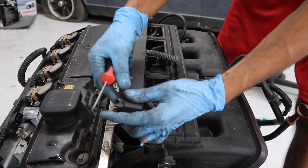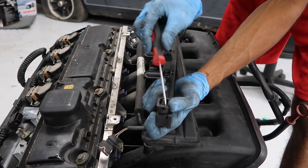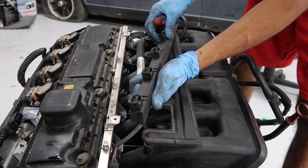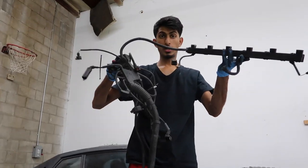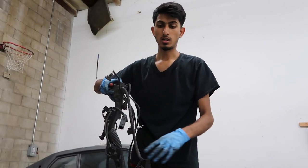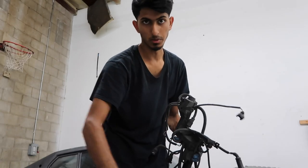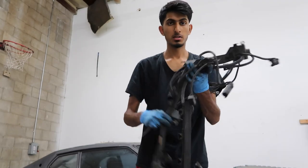Here are the metal clips — when you pull them apart, it releases the clamp and you can pull off the whole connector. Make sure you don't lose any of these pins. When reassembling, you don't have to have them separated — just push it on and it'll work. The O2 sensors were already unhooked; if they weren't, just remove them and pull them apart.